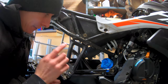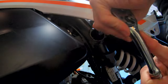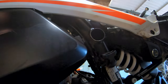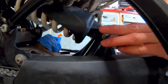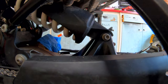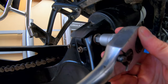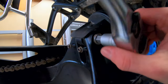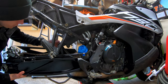Right, that's the bike stripped down — now it's time to undo the relevant bolts and take the rear shock out. This is the first bolt to undo — loosen it off, back it out a little bit, but don't actually remove it yet. Then go to the bottom one, there we go. Pop round to the other side — we just need to back off this adjuster. It's a left-handed thread so you have to do it up to loosen it. That should do it.